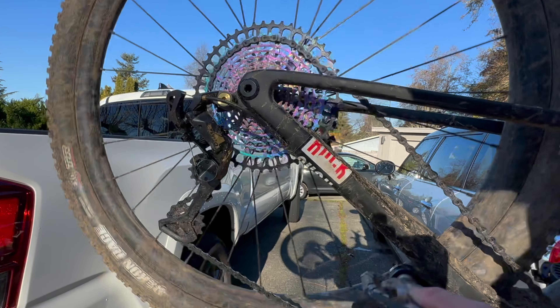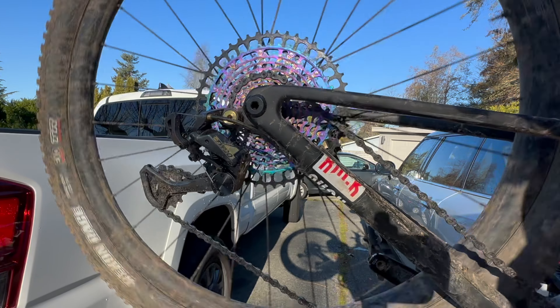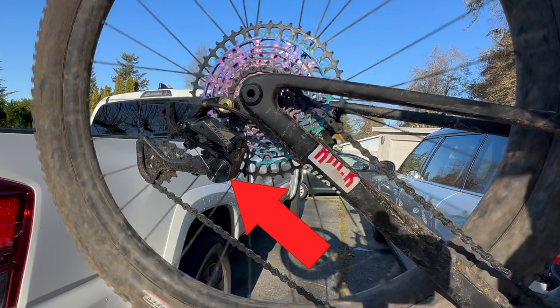Let's dive into the nitty-gritty of this component. When we shift gears the chain needs to adapt to different sizes, and this task is handled by a spring in the derailleur cage. However, relying solely on the spring can cause the chain to jostle under quick forces like going over rocks and roots or landing on jumps. Enter the clutch — a mechanical component designed to keep the chain tensioned under sudden forces.